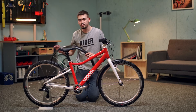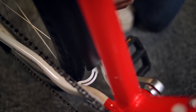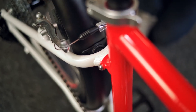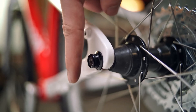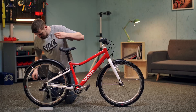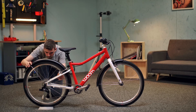When it comes to mounting the rear fender, all the models work the same. Thread it around the back wheel and slot it into the opening between the two chainstays. Make sure it is also sitting nicely in the mount. Now we need to click the stays onto the end of the axle. If your fenders are wonky, you can straighten them by adjusting the length of the stays before attaching them to the axle.